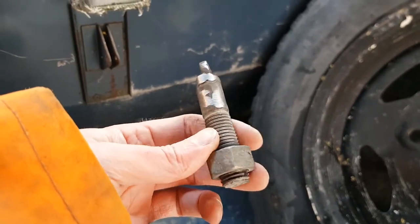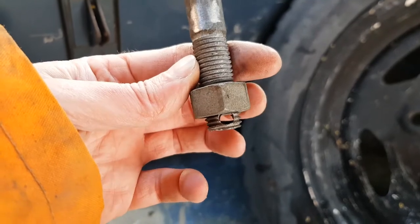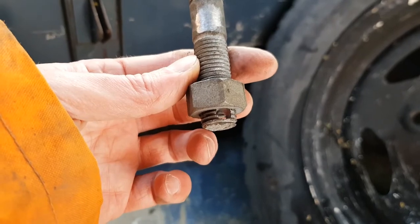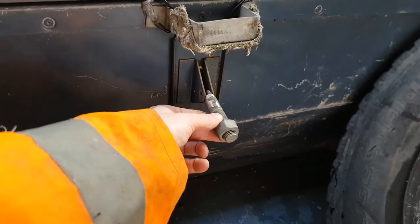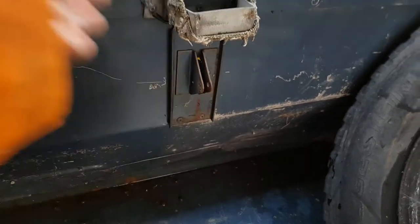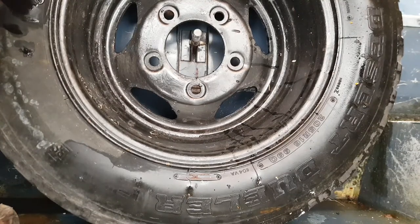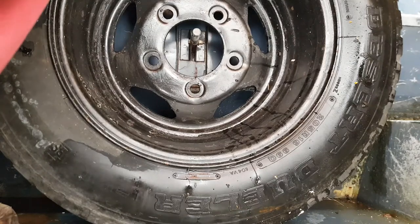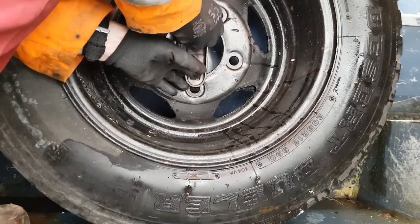You can buy them but I just wanted to make my own. I also drilled a hole in the end so I could put a locking device — a padlock or a split pin or something like that. So that goes in there, a bracket goes on and it mounts the spare wheel. I've put that little spigot on now — I've made one — and it's just a case of putting on the bracket. I think it goes a bit like that and then tightening up the nut.